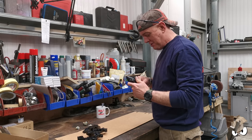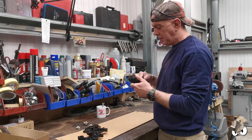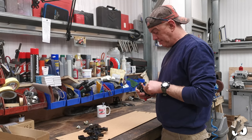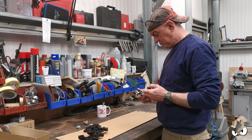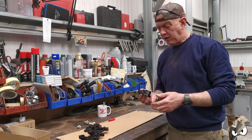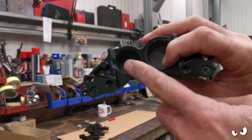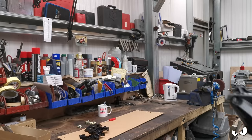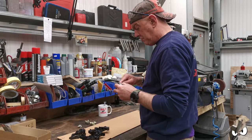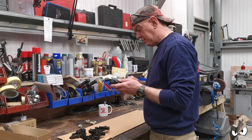What's up YouTube, my name's Quickie, welcome back to the channel, back on Aisberg again today. I've got all their calipers - they were painted in the last video. You can see they've just been dangling in the corner for days whilst I've been working away on the mill. She's basically there, so what I'm doing is having all the masking out and we're going to stick them back on the bike, do all the lines and do the master cylinder as well. They turned out all right - I just used some of that Hammerite smooth aerosol paint, not VHT or anything else. Inside we've just masked off where the pistons sit and the mating surfaces for the galleries.